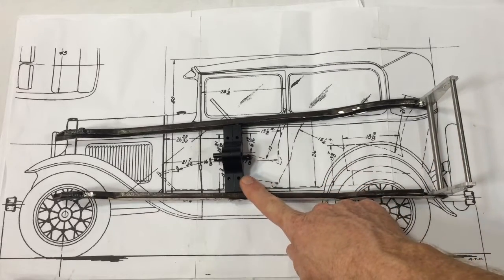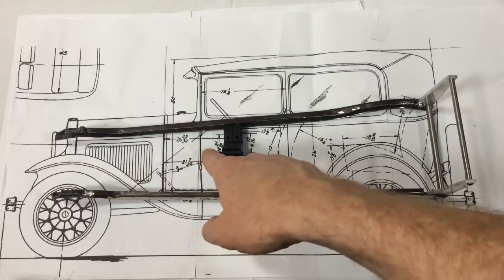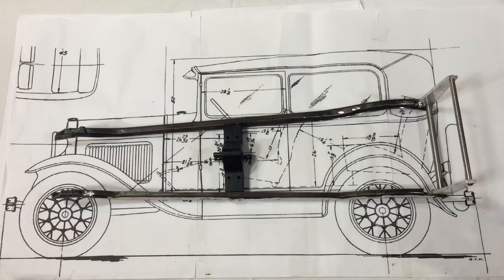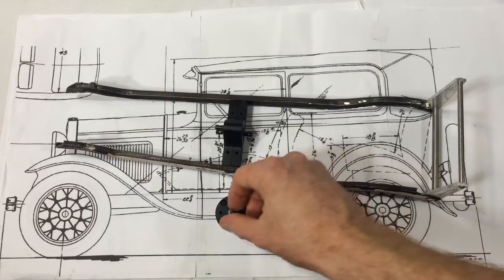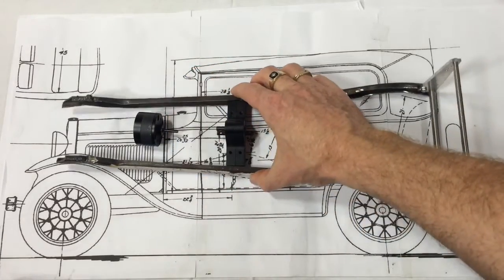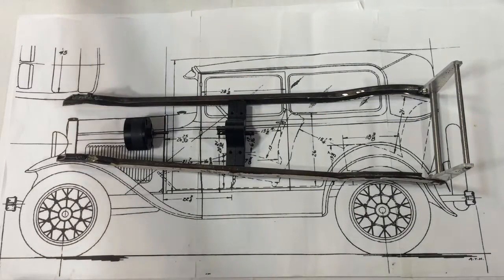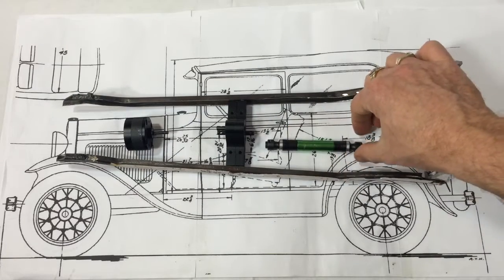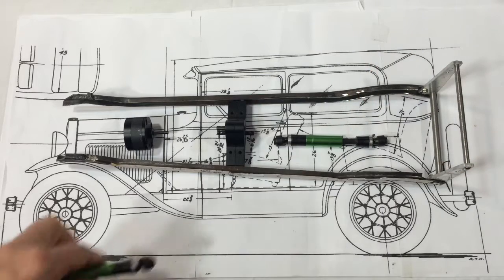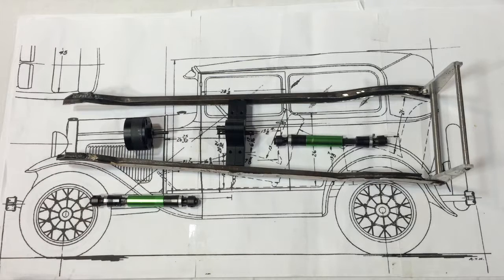Center transfer case is actually going to provide power to the front and rear axles. The motor will power into that. The motor is actually going to run into my planetary gearbox. So there to there. On my channel I've got another video on these little beasties. A couple of Top CAD drive shafts, got them cheap off the internet. I'm using them because I have them, therefore cheap.